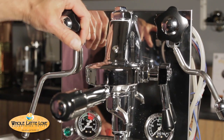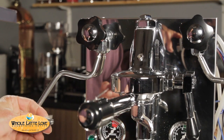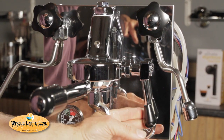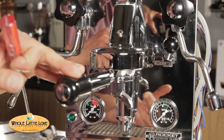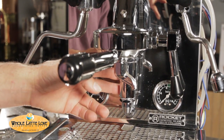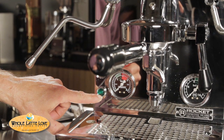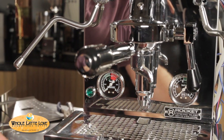Let's talk a little bit about the front of the machine. Here's your steam knob, which controls your steam wand — no-burn steam wand, two-hole steam tip. It has good pressure. That just unscrews like that — you've got a little gasket there, a little rubber o-ring. Over here, we have the hot water dispenser — again, a knob; a lot of steam comes out of this. Over here, here's your lever for brewing. You push it up in this position — middle position — for a little pre-infusion. It allows the water to flow into the coffee. Push it up fully to activate the pump. When you're done, push it down and it releases the water off the brew group down into the drip tray. It's a manual three-way valve. You'll hear some machines, they talk about a three-way solenoid valve, but this is a manual — solenoid means electric. On the side here, here's your main power switch. This green light will come on when everything's in good order to operate; it will flash when you're low on water. You have your steam pressure gauge over here and your brew pressure gauge over here.